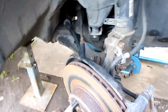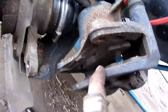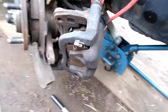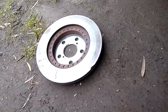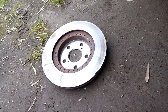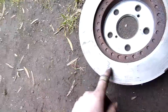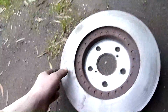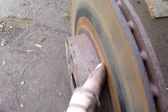Anyway, onward. Okay, well, I've got it apart. There's clearly plenty of pad left on these. They're not all that old. Like, these rotors weren't all that old, apart from the fact that they let the car sit around so long that they rusted up, and I'm guessing it hot spotted where the rust wasn't, like where the pad was, and warped them so badly that they machined undersize. I took all that material off. You can see the step there.